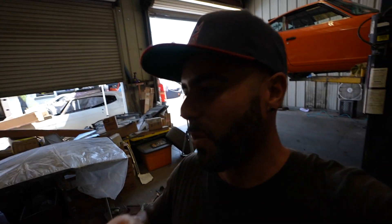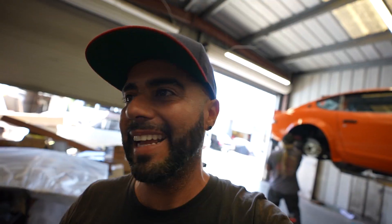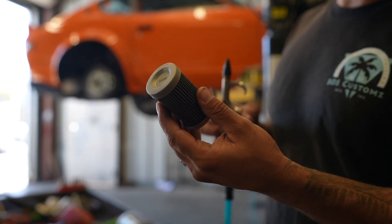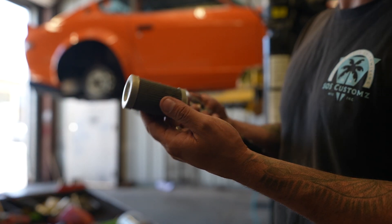On a serious note, we're going to go ahead and get this bracket off, get the fuel pump out, and replace it. It was running terrible — it's not getting fuel, it was up and down. It needs it. After that we'll be able to load a new map and make some power. Here's the filter; it's still reusable — it's metal, stainless steel — so we just want to clean it off.